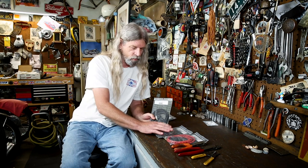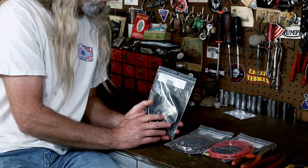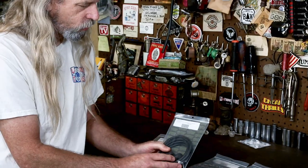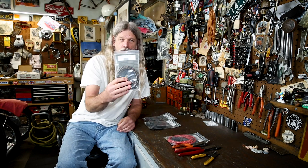Let's talk about that for a minute. We have cloth-covered wire — we have kits and we have wire by the foot available. We've changed up the kits now where we've got different ends in them — we have 90 and straight boots. The most importantly is we have seven millimeter and we have eight millimeter. The seven millimeter that we've had for a long time is going to be stranded copper core. The eight millimeter that we've been stocking for a little while now is suppressor core. If you have an old motorcycle with points or a magneto, you should be using seven millimeter stranded copper core wire.